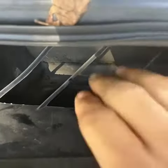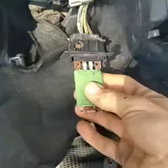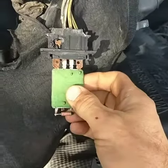Also check inside here — if you look very carefully you can see the fan blades. Stick your hand in there and spin them, make sure that spins. If it doesn't spin, it's stuck and you need a new motor, which is right behind here. Otherwise, you just need a new resistor — millionmilespinder.com.